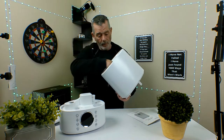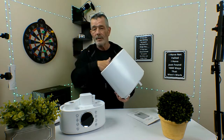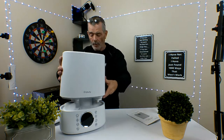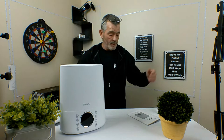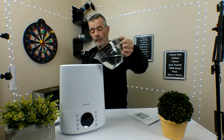Very good. A lot of times you can't get in there to clean it — it can get slimy in there sometimes. You also want to use purified water in this thing. You don't want to use tap water because tap water has calcium and sulfur and all kinds of stuff in it that may put a white film on things around your house when the mist settles. So you're going to want to put purified water in it.